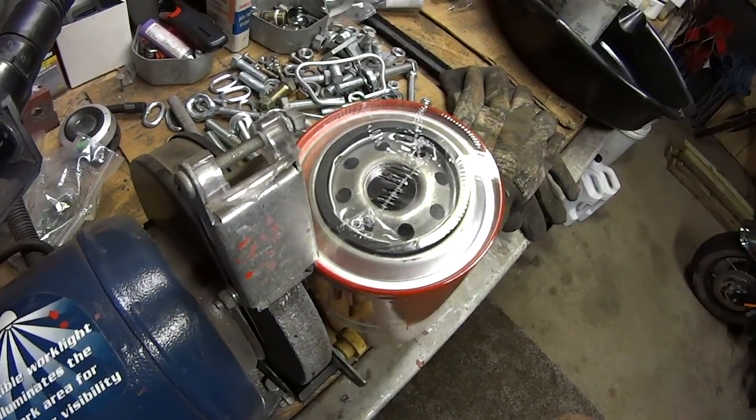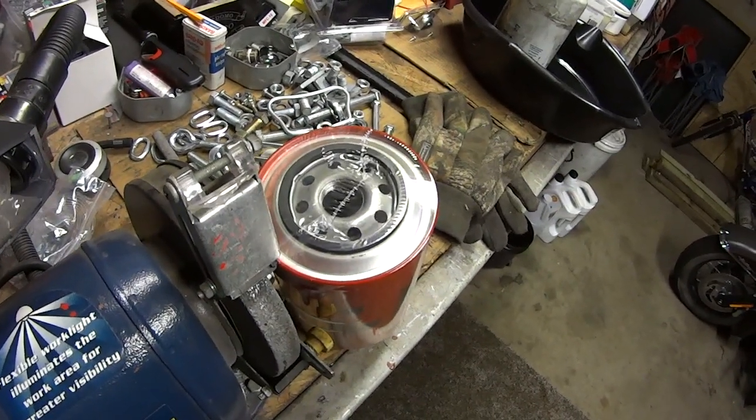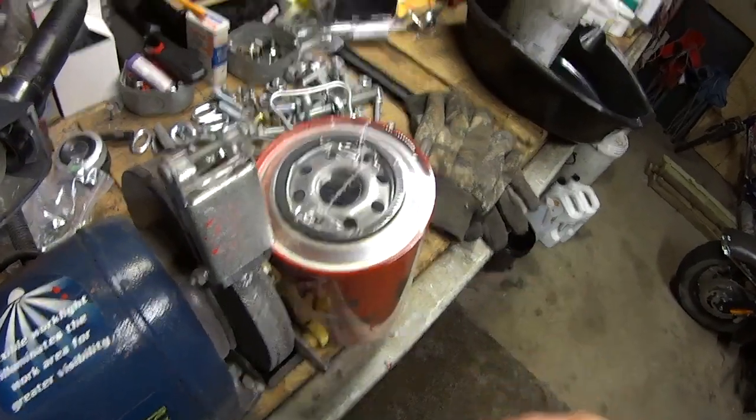If it's just little dust particles — these engines are kind of sensitive, especially the newer ones. I've been doing this for years and most mechanics prefer to pre-fill them. The reason is these two filters together hold probably about a half a gallon of oil, and when you start your engine up it takes a little time to fill these filters. You don't have any oil pressure until these things fill up — something like a camshaft spinning at really high RPMs with no oil is just not a good thing. On cars it depends — if the filter is upside down or sideways you can't pre-fill anyway. But on diesels, because there's so much oil in the filters, I find it best to pre-fill them.